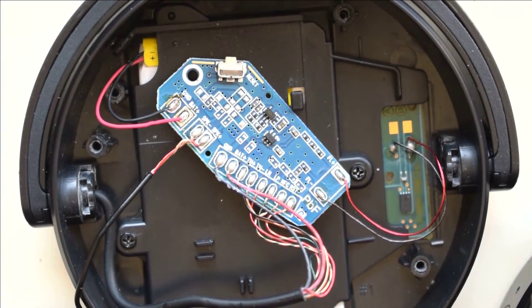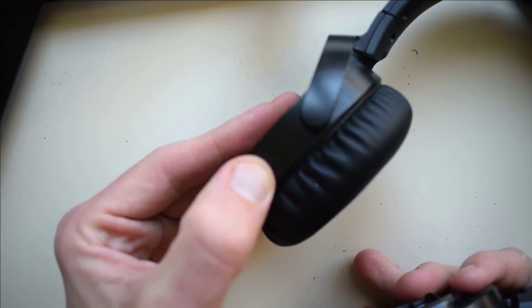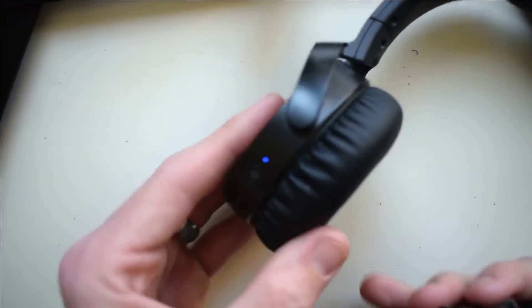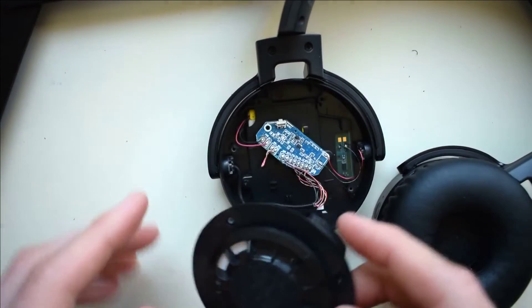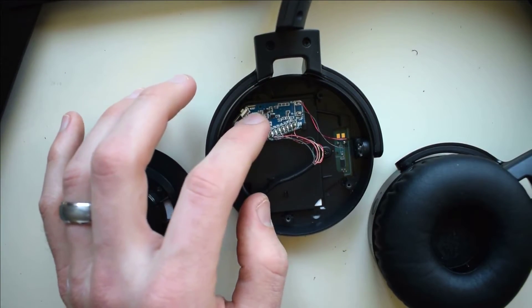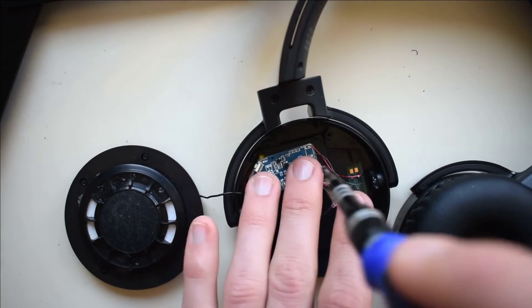Now's a good time to go ahead and check if it's successful and try to power it on. I'm just going to go ahead and hold the power button, which is on the right side. And we have life — so that's great. The battery may power on automatically once you have it soldered in place. But if not, power it on yourself. If it still won't power on, try to plug it into a charger and charge it up for a couple minutes. It could just be that the battery doesn't have any juice left.